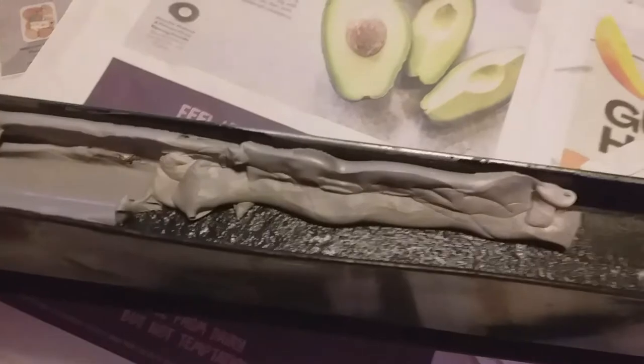I've removed the backing off the adhesive — the black stuff is my Bostik press stick and the rest is automotive bolt-on panel body sealant. I've put a little bit extra down there just in case. I haven't had to remove all the backing — just up the top to get this lower rail in, which is the first rail to go in — the bottom channel. I'm going to screw that in right now with four screws — one, two, three, four. Here is the bottom channel with its aluminium fixed glass stop in place, all screws ready to go in.